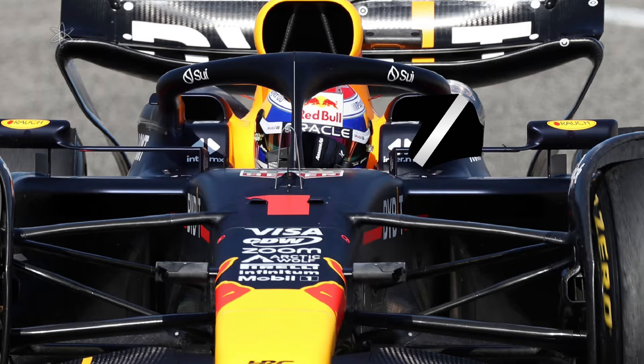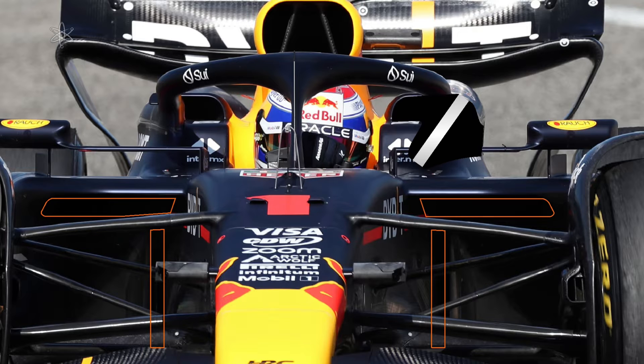Directional airflow closest to surface area moves at a lower rate than those further away from it. It seems that what Red Bull Racing has done on the RB20 to minimize sidepod air intake compromising undercut performance is to place narrow dimension intakes along the x and y axis — that would be horizontal and vertical intakes in the undercut surface area — capturing only the lower velocity section of airflow, as this is less influenced by surface area and will continue to maintain this energy for undercut performance. The air in this region would still have high pressure, so it would be forced into these air intakes providing powerful airflow.